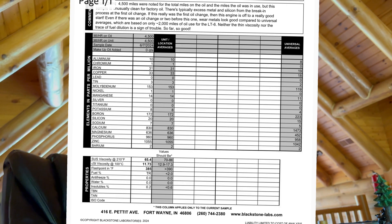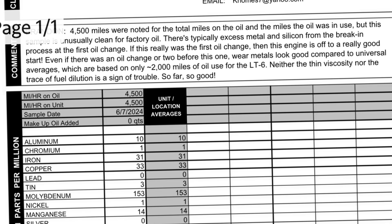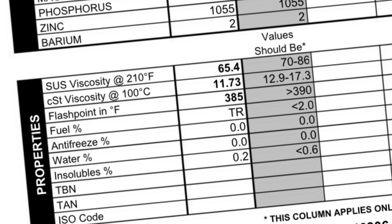Let's talk about the oil analysis. These averages are based on a 2,000-mile oil sample. Mine had a little over 4,000 miles on it. According to Blackstone, it's very, very clean considering this is a break-in oil — not a lot of extra metals and silicone that they normally see, which is a good sign. The only thing that's a bit concerning is if you look at the viscosity: at 4,000 miles the viscosity had already started to decrease. The service intervals are based on how you drive, but you're probably going to hit 6,000-plus miles before the oil change light comes on. So it might suggest we should be changing the oil a little earlier. There's not enough convincing evidence yet — we probably need more analyses — but given the DCT filter findings and the decreased viscosity at 4,000 miles, there's definitely no harm in doing so.